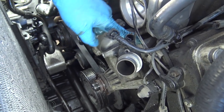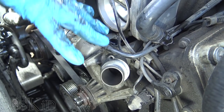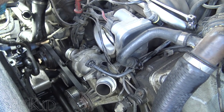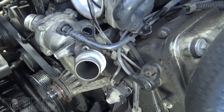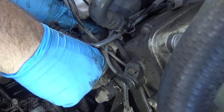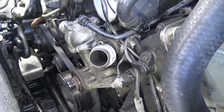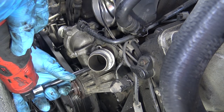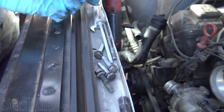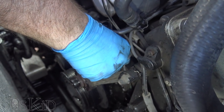This thing is going to have two coolant pipes up in the top here, and it's likely we're going to end up pulling them off because they actually run underneath the intake manifold to the back — they're crossover pipes. It's possible we're going to pull them out as we're pulling this water pump off. If that happens, we're just going to reach back and flip them back in where they were. I'm going to try at least to not pull both of them off. I want to get this thing sort of loose. No — I forgot one. I knew I forgot one. This is another long one — similar to the other long one, just goes on the top. Now that thing's loose.